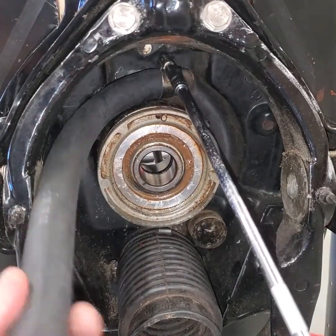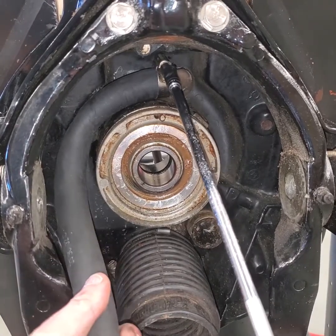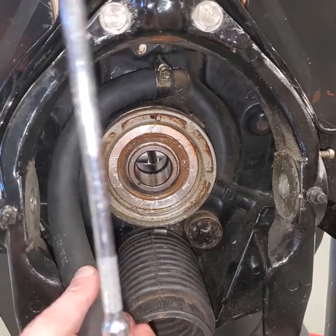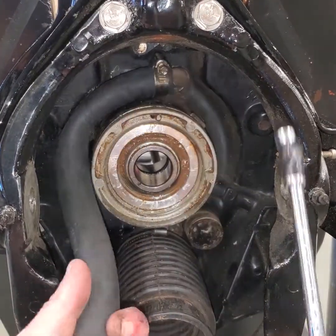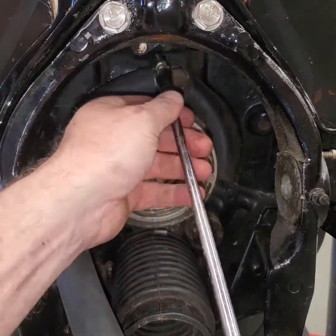One more check to make sure that hose isn't going to have any kinks when it's pushed back in here, because when you push the bell housing it's going to slide back in there. So I like to just kind of wheel it around before I tighten the hose clamp up.